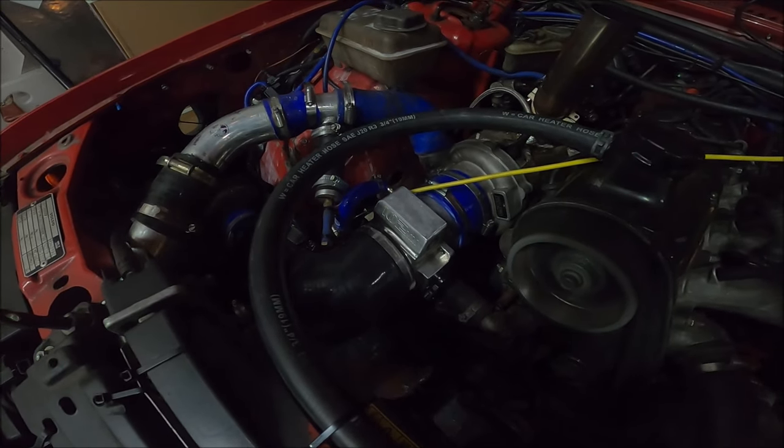So now I'm going to go back in the car and swap the chips on the ECUs to the new improved ones that Martin Leaf's done. Technically, all he should have done is increase the rev limiter. But even he's not 100% it's going to have worked, because thanks to these stupid basic ECUs, there's about 5 different bits of the programming that can affect the rev limit, and it depends which ECU, depends which bit it reads. So he's not even 100%. He basically said, let me know, and if it doesn't work, it'd be one of the other ones he's got to change. But hopefully it will.